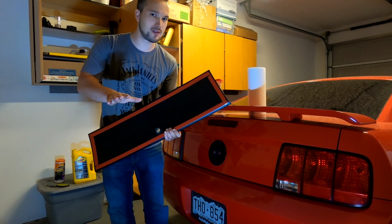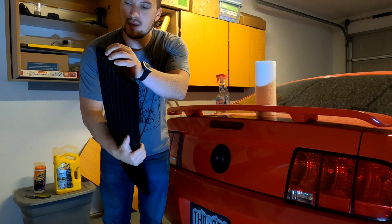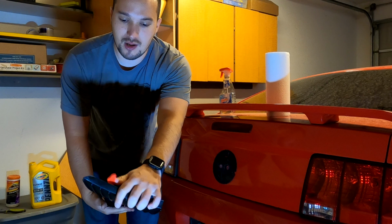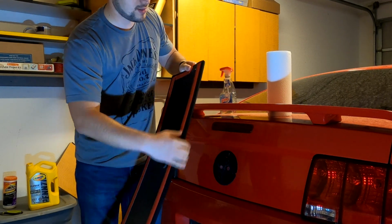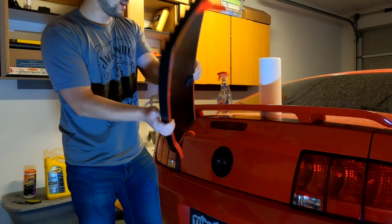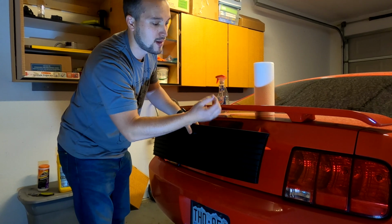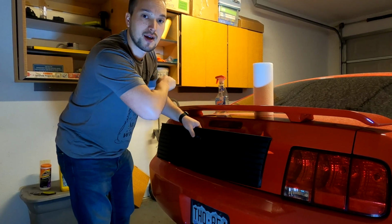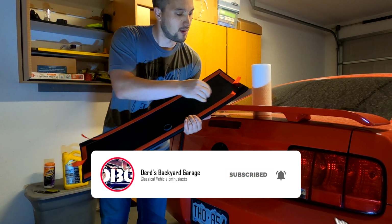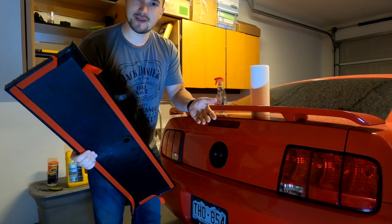You have a few choices when you do this. You can start to peel the tape, getting a small tab-like thing on all 4 sides, just like this. One here, and one down here. So it looks like this. Stick it to the vehicle with the tabs outside so that you're able to pull them off, and then slowly remove it as you apply it to the vehicle. That prevents you from using up any of your 3M tape if you need to readjust. I am just going to stick it on, however.